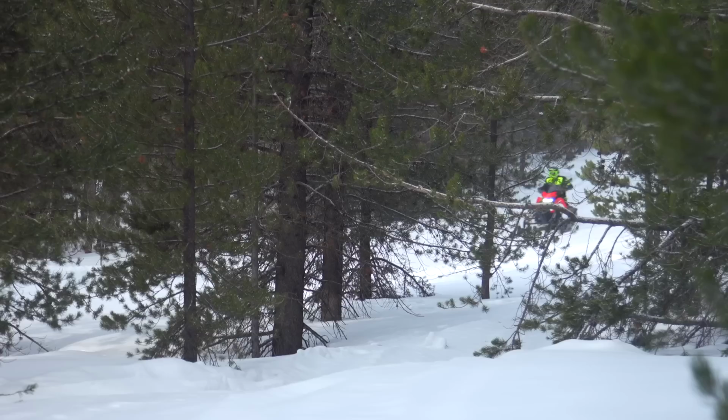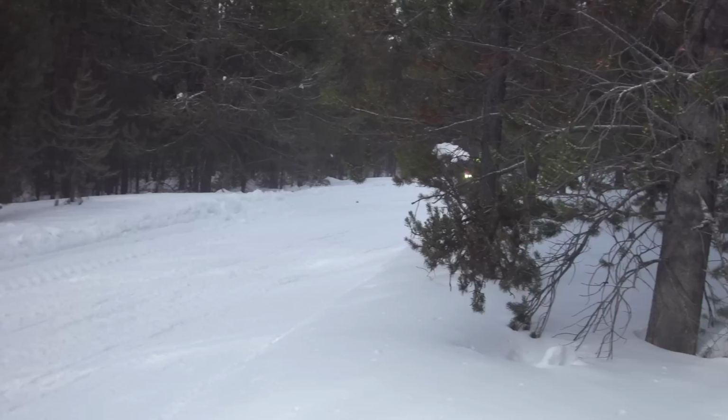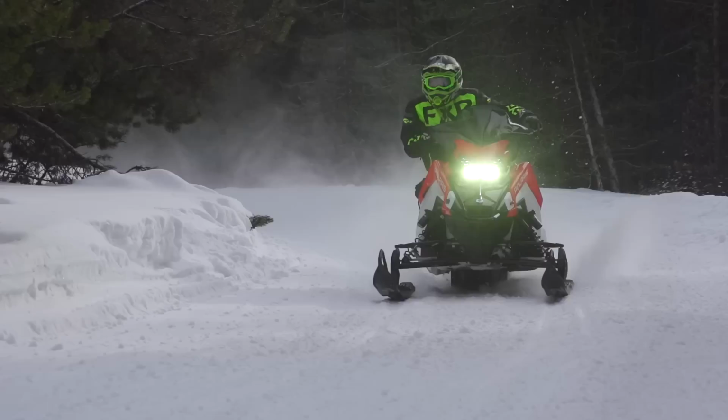In any case, the ProStar series of double overhead cam engines has a formidable reputation for stout low-end torque and peak horsepower at a strong 8,000 RPM. Peak torque on this variant is right at 7,000 RPM. If those RPM numbers sound familiar, it's because all Polaris side-by-sides and ATVs using the ProStar engine series shift out at between 7,800 and 8,000 RPM. This makes these engines really suitable for snowmobile use.